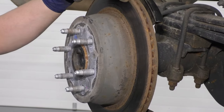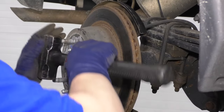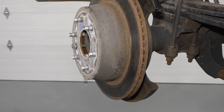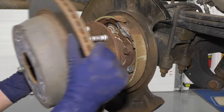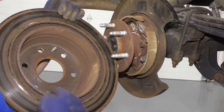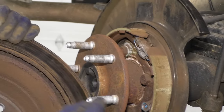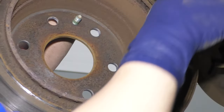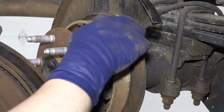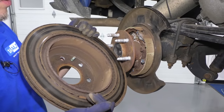Sometimes if you're going to replace the rotor, it's not a big deal — you can hammer it from the backside. Just try to spin it. There we go, got it out. Just worked it back and forth using the hammer. There is a lot of rust in there — see that rust ridge? That's what the shoes were getting caught on. It's not necessarily that the shoes were adjusted out too far; it's just that rust ridge. Even the adjuster isn't pushed out that much. There's a little door right here — you could loosen that up, but it probably wouldn't have made a difference. You just got to work at it.